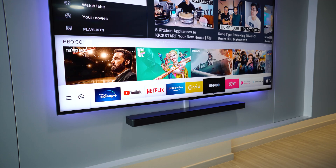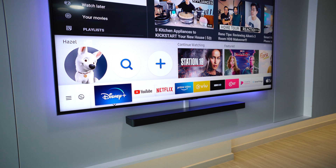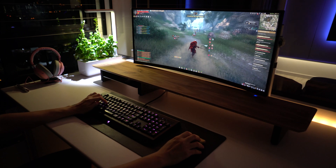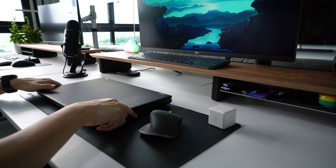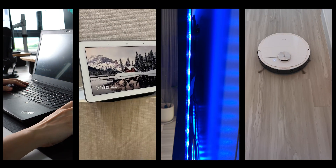After deciding on the mesh router and which product to get, next comes the most important part — how should you run a setup and where exactly should you place your mesh nodes? First of all, you need to understand: nothing beats a wired connection. Now is the era of TV streaming services, so every TV in the house I would recommend a wired connection. For PC gamers, there is no tolerance for latency, be it laptop or desktop — just go with wired connection as well. If you have a laptop that is purely for work, then it's alright to use Wi-Fi. So Wi-Fi is basically for your mobile devices and smart home devices.